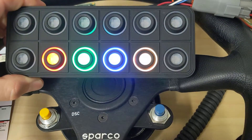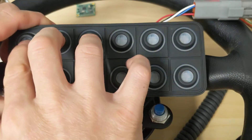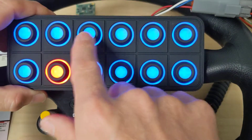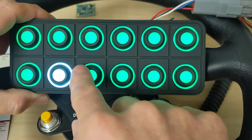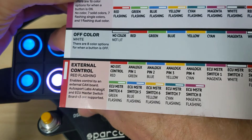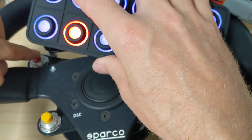These are the buttons right here, color coded to match our buttons. To do that, let's go into configuration mode like normal. I'm going to select this button — I forget what color that button was — let me check. It's red. So let's go in and change its external control parameter. I need to press the parameter button until it gets to red flashing, just like that, then confirm it. Now we'll set that to Analog X pin 4, because that's what's connected to my red button.